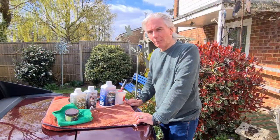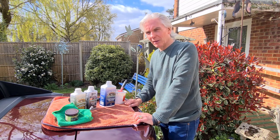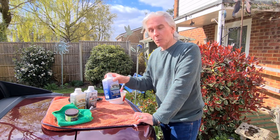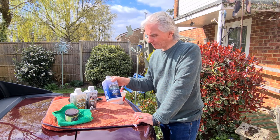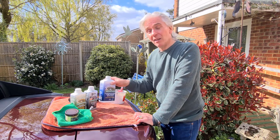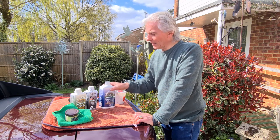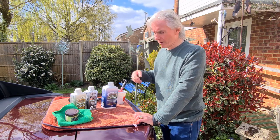Stage, it's absolutely jet black. It looks absolutely perfect. You think, ah, that'll do, I can't be bothered to do anything else. Don't miss the next stage, it's very important, which is the waterproofing. So we're going to use Renovo's ultra proofer. I will warn you, this can be a bit annoying, and the reason for that is the first coat goes on really well. It's very easy to do. It gets absorbed into the roof quite well. You start from the center, move out and all the rest of it.